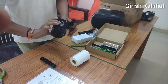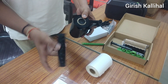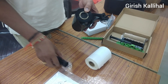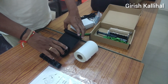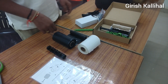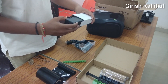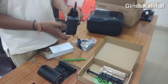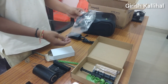These are the accessories used for installing the labels and the carbon. This green stick type accessory is used to hold the barcode label — we need to insert it inside and install it in the printer. This other accessory holds the carbon ribbon. I have already installed it. You can see L and R printed on it — L means left side. One stick loads and the other unloads. There is also a small box with an adapter for attaching to the power cable, and a cable for connecting the system to the printer.